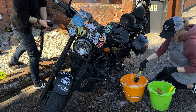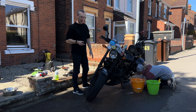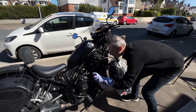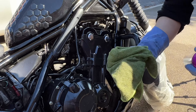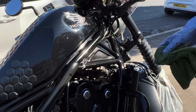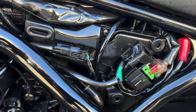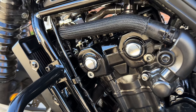I've got the bike dryer and I'm basically starting to dry everything off from the top down, because before we apply the ACF-50 we want the bike to be really dry — bone dry. Now I'm showing AJ a few tips on using the ACF-50. I've been working it in with my detailing brush — squirt it, it starts creeping into all the parts of the engine, around nuts and bolts. Get your detailing brush and work that in. This microfiber cloth already has some ACF-50 on it — great for the tank and down the frame as well. Remember: ACF-50 was first created and invented for aeronautical use.